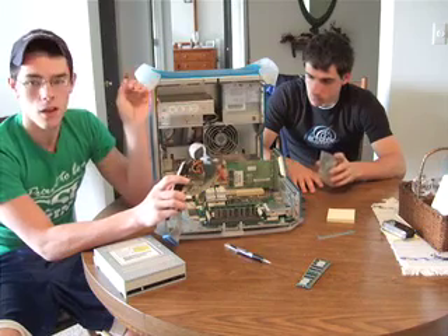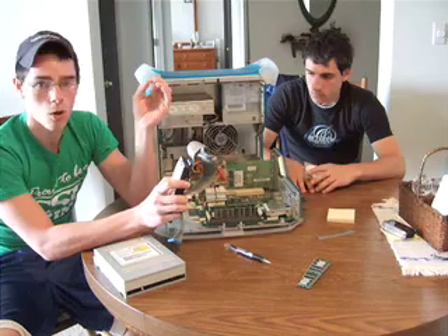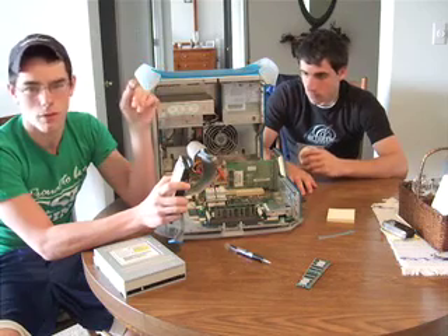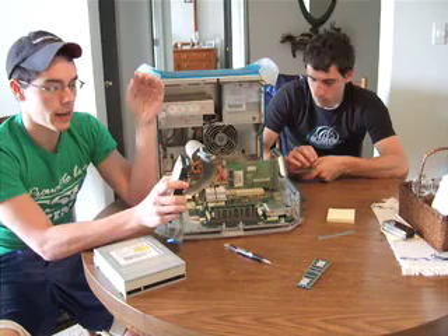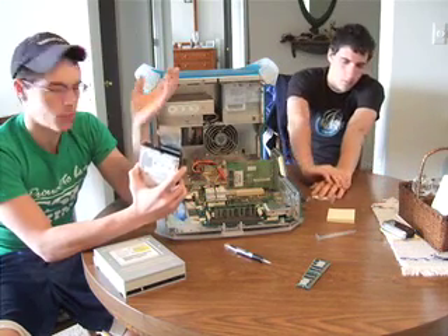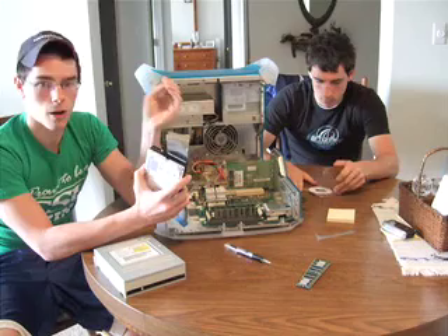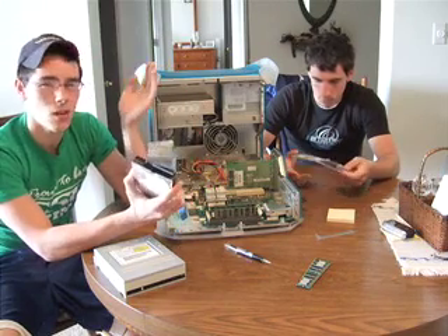A little bit more about KillDisk: KillDisk will not run on a Mac computer. You need to be able to access the BIOS setup, which I don't believe you can do during a Mac's boot up. But on Windows, we've all seen it — press F12 to enter boot menu — and you boot from the CD-ROM which has KillDisk. What it does is overwrite all data on the hard drive with all zeros. You can choose different levels of rewrite, but a single pass all-zero on a 40GB should take about half an hour, maybe less, maybe more.